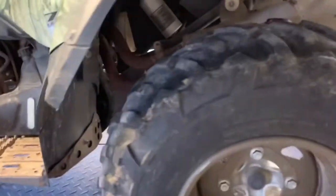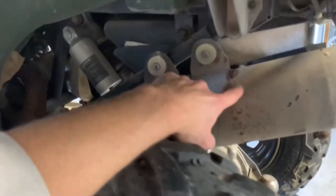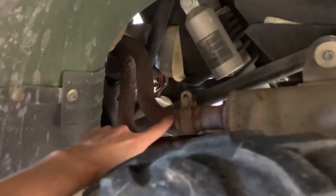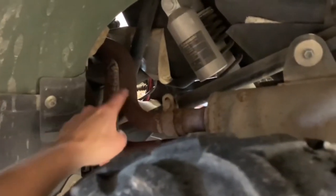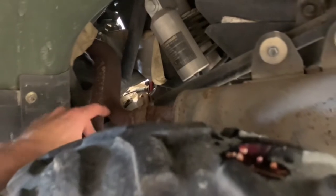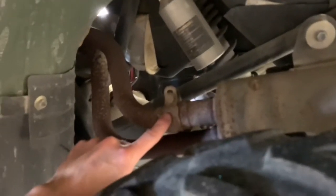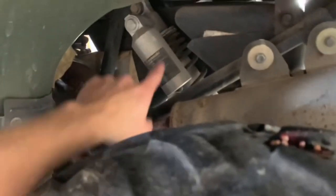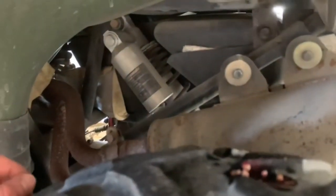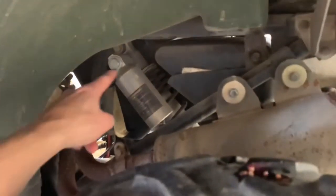Moving around to the back left-hand side, you've got your exhaust muffler, silencer, or canister. Because you've got twin cylinders, you've got your rear cylinder and your front cylinder both coming in here. Make sure there are no holes and the clamps are on tight. You've got a rear shock here with some adjustment up top — there's a spanner nut to adjust that shock, and we can do a separate video on that.